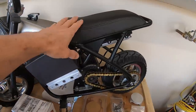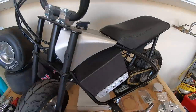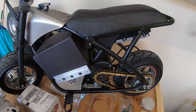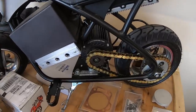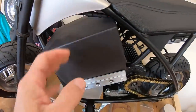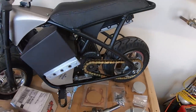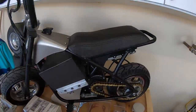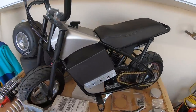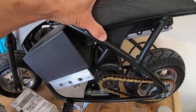This bike here I picked up on Facebook Marketplace or Craigslist — I get a lot of bikes on Craigslist, Facebook Marketplace, or yard sales. This one started out as a 24-volt electric kids bike and then I converted it to an Electro Enco QS90 72-volt kit. I used one of their 72-volt lithium-ion batteries, made a custom battery tray, a custom motor mount, and a 428 sprocket. The bike does around 55 miles an hour, so I added a single piston hydraulic disc brake. Going 55 miles an hour on this bike feels like you're going 100 — it's so tiny. This bike turned out to be fun; I have quite a few race videos on it on the e-bike playlist.